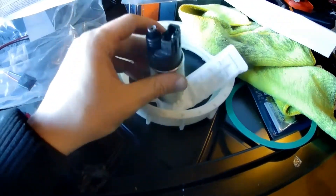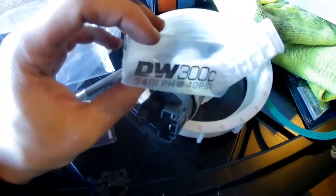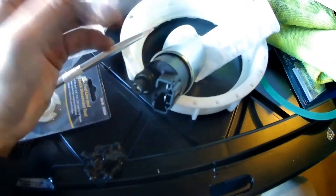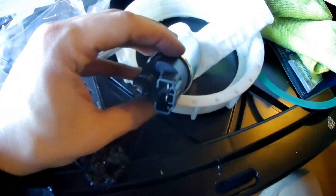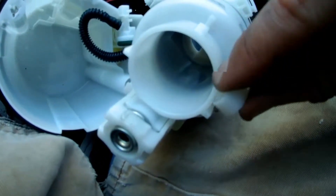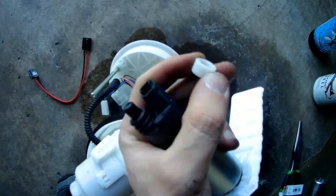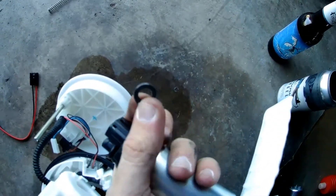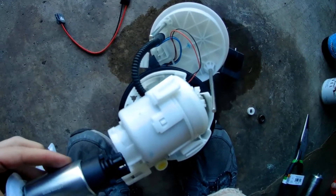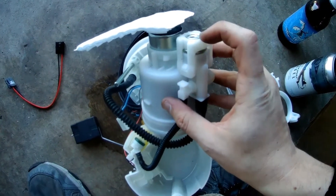When you put on the fuel sock, the label came off so I'm just going to leave it off — I don't think it should be in there anyway. So now we just put the rest of the stuff back together. One thing I forgot to remove was the spacer — you have to remove the spacer from in there. So we have three O-rings, and we removed the spacer and the other O-ring up in there. Now we just connect it in there and push it in. I got the fuel pump back in and I put the clip back on.